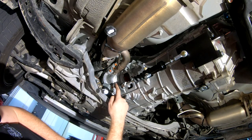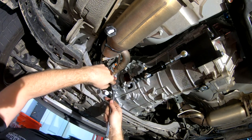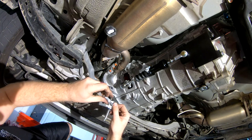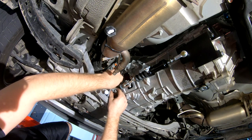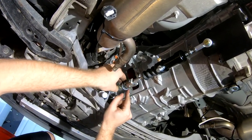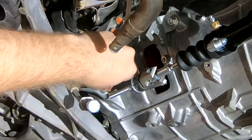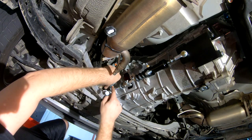We need to remove this bolt connected to the starter because we need to attach the other washer to it. Take that washer, put the spring on it, set it on top of this wiring harness bracket, and then reinstall that bolt back on. Don't torque that bolt down all the way yet. Go ahead and locate where that hole is on the other washer, try and get those two holes to line up, and stretch the spring so it attaches to that other hole. Rotate this around until the two of those line up, then go ahead and torque down that bolt.